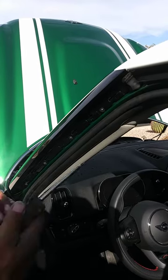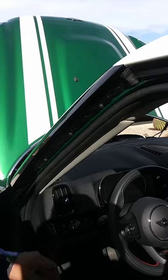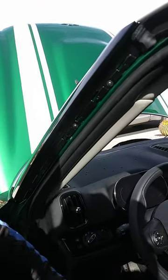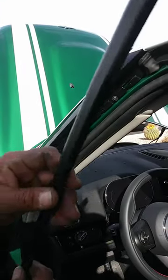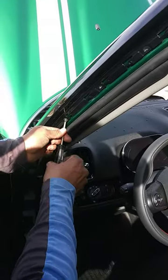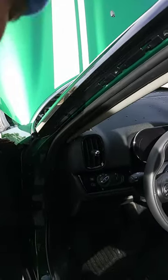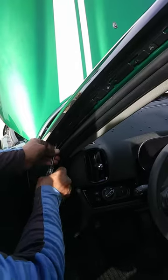But you're going to have these T20s underneath that I didn't know about. So if you're doing a Mini Cooper 2021 Countryman, you're going to have side moldings with T20 screws on there — the cover slides down to take it off, slides up to snap it back on. And you're going to have clips underneath this molding as well, so you'll have the T20s and T15s.